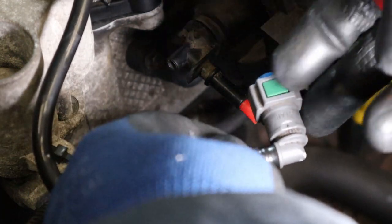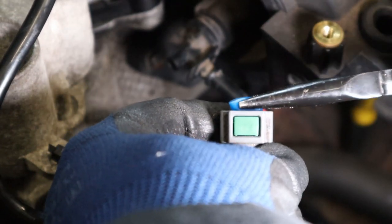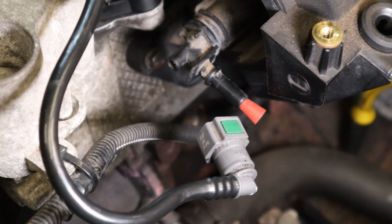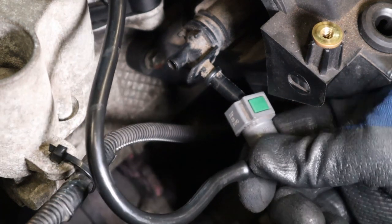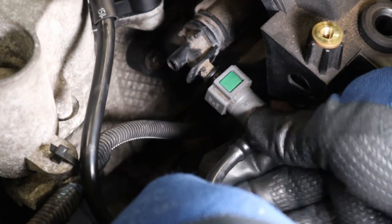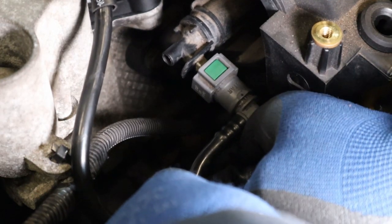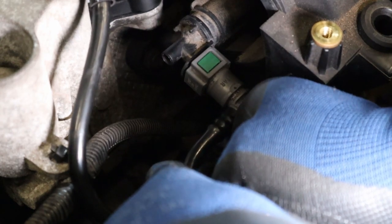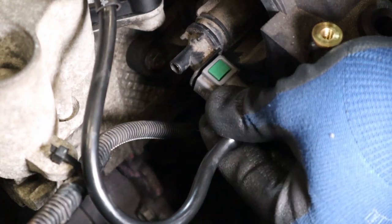Firstly, you're gonna wanna remove the bungs that you fitted. You might need a pair of pliers to make it easier to remove the one in the pipe itself. And then grab the one out of the fuel rail as well. And then push it onto the stub on the fuel rail until you hear it click. And then a quick pull, just to make sure it's secure.